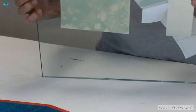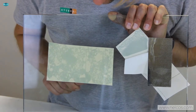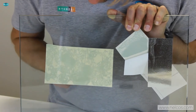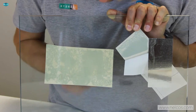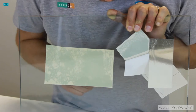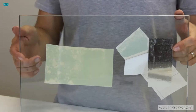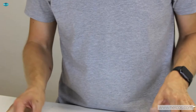I'm going to show you on this piece of vinyl — right above my thumb there's an air bubble — and as I push, I'm able to push that air out. That all goes through these different channels and helps you get a perfect install. When you're selecting vinyl, depending on the job, you always want to make sure that you do have that air egress release technology.